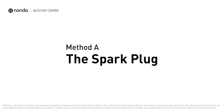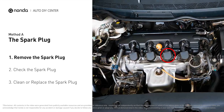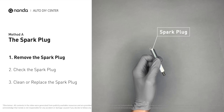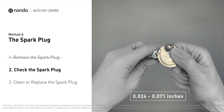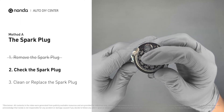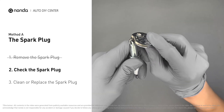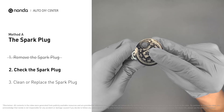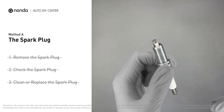Method A: the spark plug. The spark plugs are located at the engine end of the wires, under the plug covers that attach them. First, carefully remove the spark plug. Use a spark plug gapper to check the spacing — normally the spacing should be between 0.024 to 0.071 inches. As you can see, the spacing of this spark plug is a bit low. Use the spark plug gapper to increase the spacing back to the normal range. But if you see there is obvious damage on the spark plug, simply replace it with a new one.